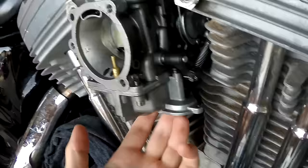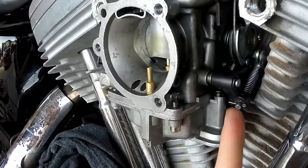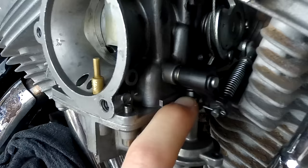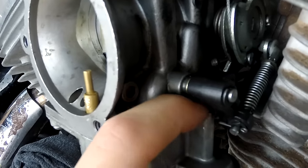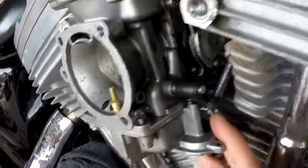I would notice that a bunch of gas would leak off of the side, and after pulling everything off, I realized it was coming from this little boot right here. I don't know if you guys can see that little black piece right there. It's really not a seal, it's just a boot. It goes over your accelerator pump. Not when I would turn the throttle, but when I would let off of it, it would just flood this whole area.